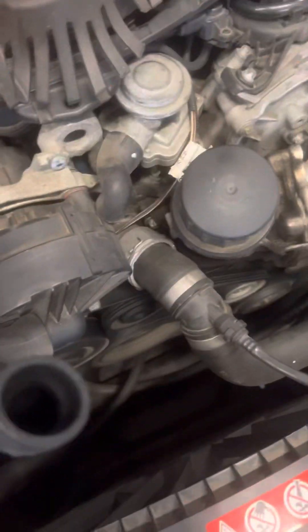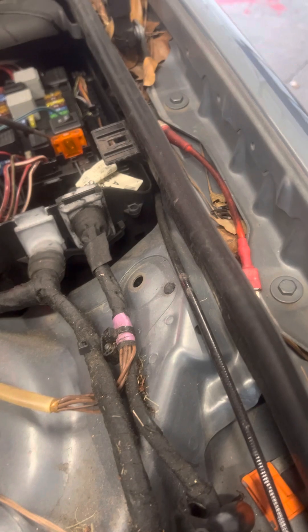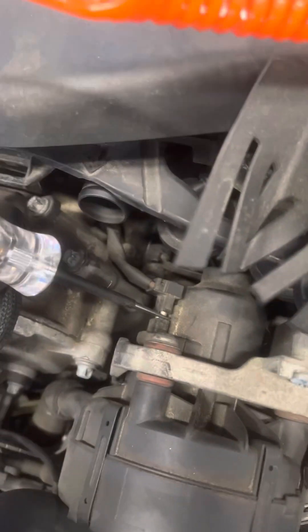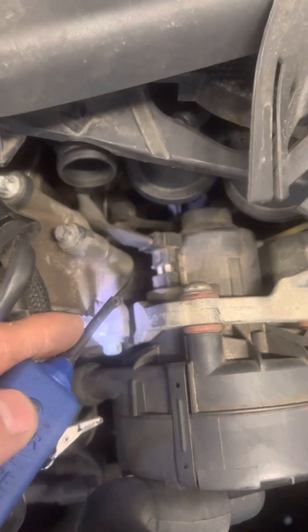So I replaced the fuse. Now it's triggered and I'm getting my grounds with the test light. It's got juice on one side but dead on the other. The ground is on this side. You could also take a power probe — clamp the ground on the exposed terminal and power probe from the bottom.